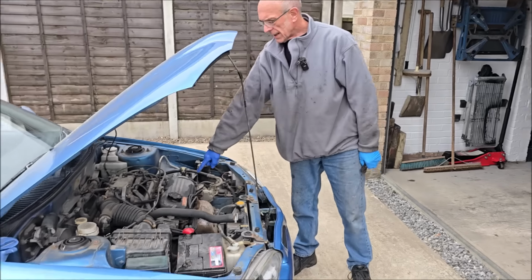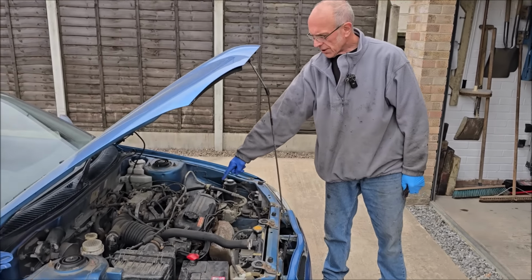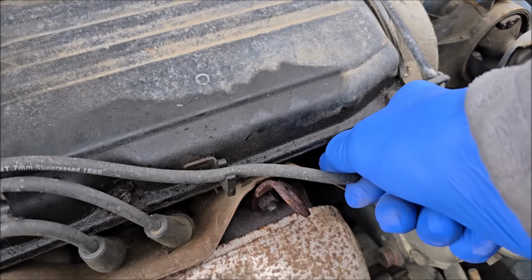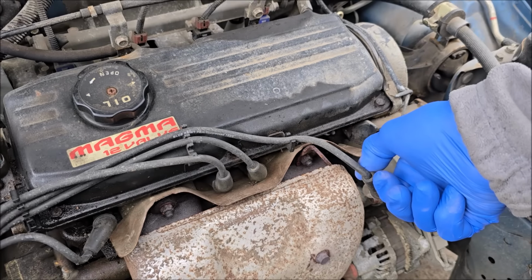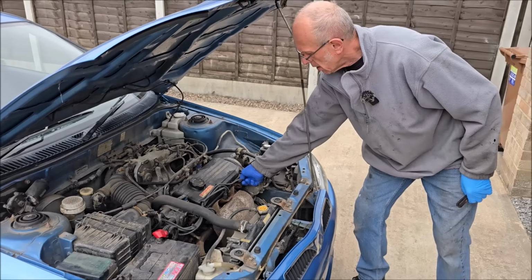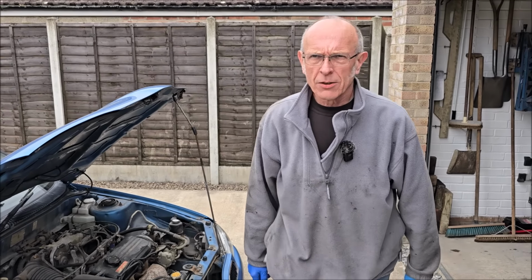What's the plan with that then? See that there? We're going to call that number 1. Is that number 1, is it? That's at the front of the engine. Okay. Right, so misfire on 1. It's running on it, listen. But not a lot. So what would you now say is the problem there? Switch it off. Yeah. And we'll do a compression test.